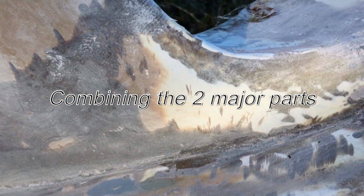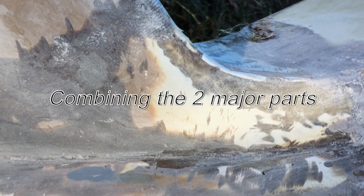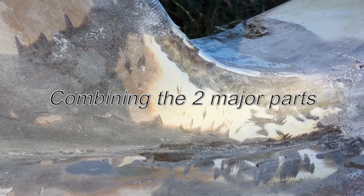Okay, I'm getting the bumper back together, people. See, right here I had to cut the seam. That's where I cut it so I could shorten it. So I re-fiberglassed that and used Bondo hair to put that back together. I still got to put another layer on it. Not Bondo, but fiberglass. Do a light sanding, and then any imperfections, fill it with the filler.